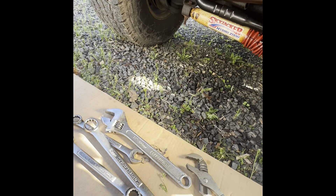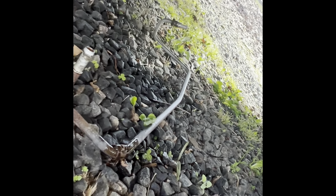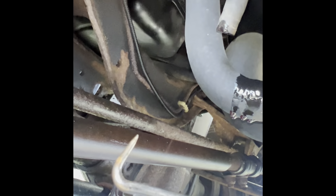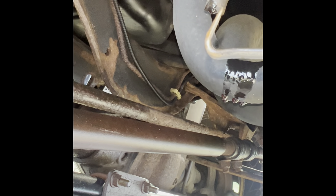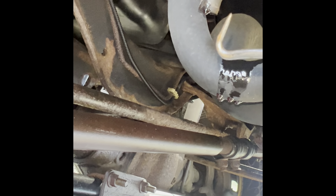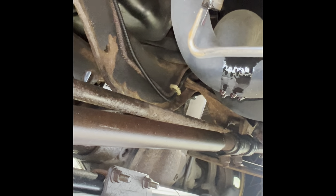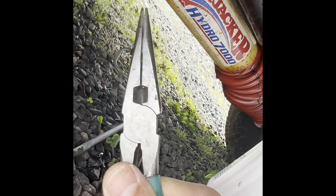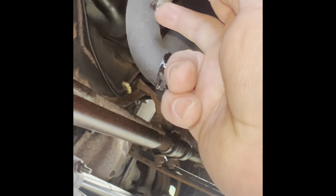Alright fellas, I got the piece of line that goes from the hoses to the driver's side. Here's the hose — it comes out pretty easy. I recommend you use a hook like this or a small screwdriver and work it in between the hose and the fitting to unstick it from the line. Obviously you have to release the hose clamp first — it's a spring style and you can use needle nose pliers for that: squeeze it and get it out of the way. If you're going to reuse the hose, try not to hurt it. If your truck is rusty like mine, I also recommend using safety glasses because everything starts coming down on you when you're working down here.